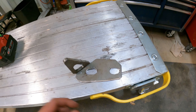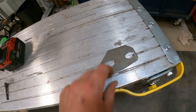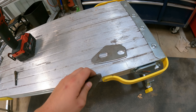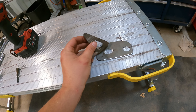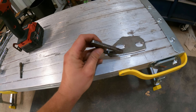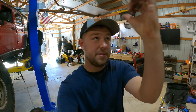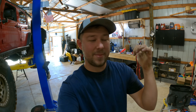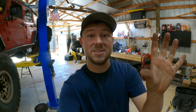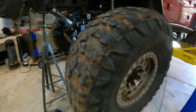What I'm planning on doing is using this little bracket that I fabbed up here the other day. This is just going to weld on there to fix the crack and give us a little more support. Then we're going to use a little gusset to weld onto that piece along to our upper control arm bracket or down here along the frame. I have a feeling somebody in the aftermarket will come out with a bolt-on way to install this, since there is a threaded tab in the frame a few inches up that you could bolt the whole assembly onto. But welding it in place is going to work for now so we can at least get this out on the trails.